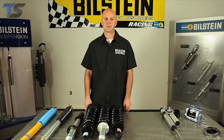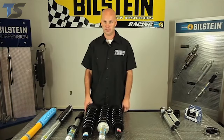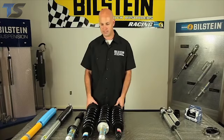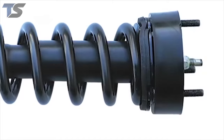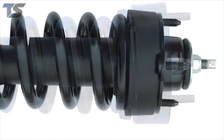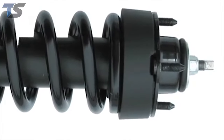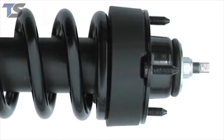I want to take a more in-depth look at why a Bilstein 5100 ride height adjustable is a big improvement over a spacer kit. Now there's two basic spacer kits on the market today: something called a strut extension, and also a preload kit. The strut extension is a spacer that's put on top of the coil over assembly — basically it spaces the whole assembly down. A coil over preload spacer is basically fit in between the upper mount and preloads the coil.